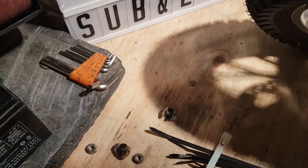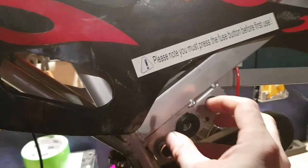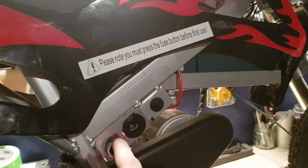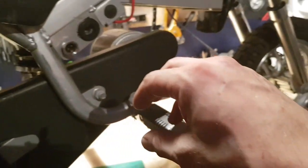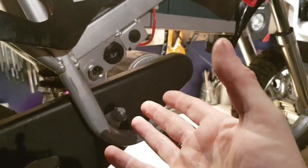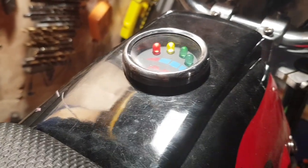Oh, 2 seconds. Right, so I'm going to show you guys for the ignition. That was just popped out, dropped the back out of it, and then took this chunk here, the metal part that was inside it that takes the key. And I actually put it in the vise. Put a punch on the top and just smacked it straight through, and then put the other bit back in the back again. That was it. And now you have a switch that can just turn on, turn off, on, off, on, off. See? So we'll make him up a key that he can just use for himself.